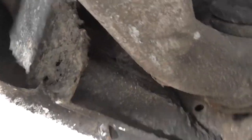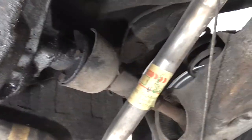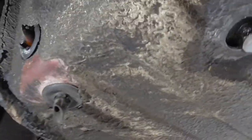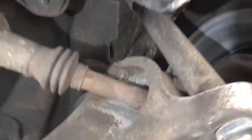Coming down the sills — it's not been jacked on the sills or anything like that. Coming onto the rear, still as it goes into the wheel arch, again all perfect. The box section of the floor there, all good. You'll notice it's got a new stainless steel exhaust on it. That's across the axle and drive shafts. The aluminium is still showing fairly well on the rear trailing arms. The handbrake cables are all free and clean. Again, a little bit of red oxide showing there — it's had a petrol leak at some point, no doubt. These are the drain off pipes — it's been overflowed. The springs there are all original with under seal on.